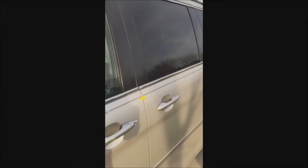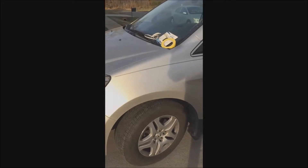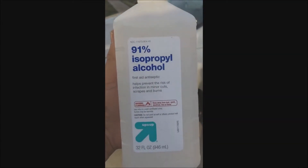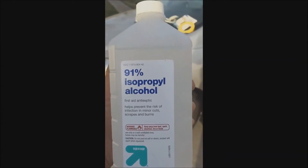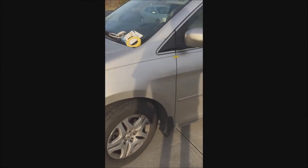It's a really good product. I've got yellow tape marks up there — a lot of us eyeball it. Guys who have been doing it a long time, you know, the safe way is just about there. Put little yellow lines and we're going to string that up in a minute. Clean the car with 91% isopropyl alcohol — that's what 3M wants you to use. It works great. You could use 71%, but this is a little stiffer; it's got 9% water. So you should prep it with alcohol and then put your little tape guidelines up.